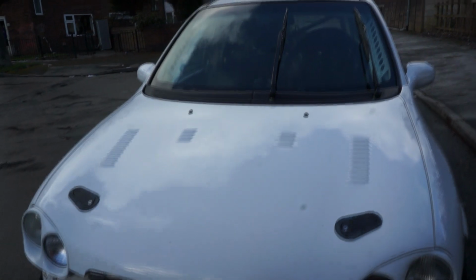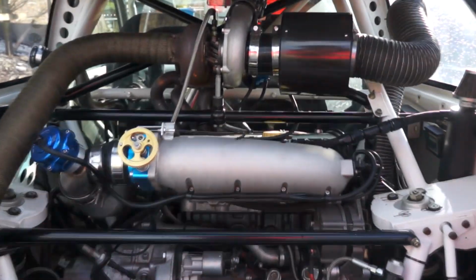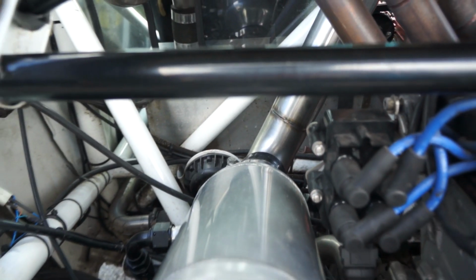So going into a little bit more depth of the spec of the car. The engines are obviously the C20LETs, steel rods, forged pistons. We put 1mm oversized valves, full ported and polished cylinder head with custom cams, custom billet inlet manifold with a cast integrated engineering plenum. I fabricated the exhaust manifold, the boost pipes, and the full exhaust system, which is full 3-inch all the way through. Both engines run a PWR charge cooler setup. It's running 1000cc ID injectors. That's the basic specs of the engine.